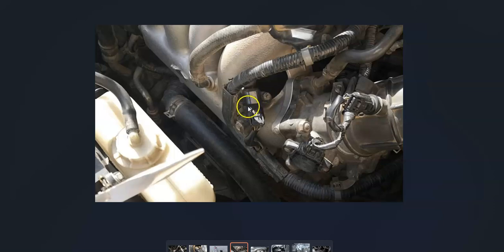The first thing to do is to find the MAP sensor. Once you do, check out the wiring harness — be sure it's plugged in good, and check it for any opens, shorts, or a blown fuse. Keep in mind that bad wiring could cause the same symptoms as a bad sensor.